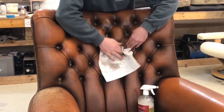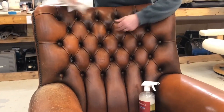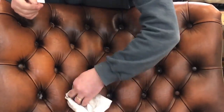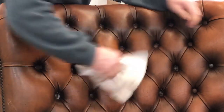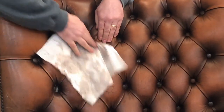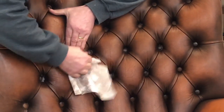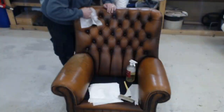There's a lot of dirt on there — that's the beauty of it. Now we've got all the cleaner on there, you've got to get in and dry between all the pleats as well to remove all the dirt. As I say, we went over this initially with the airline to blow all the dirt, dust, and grit from in between those areas. That made it a lot easier, because if you don't remove those particles, you're just going to create damage. You must make sure you get between every one of these pleats because you don't want to leave fluid in the pleats, as that can start to create dampness, mold, and growth issues.